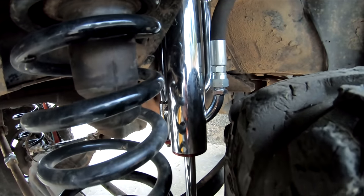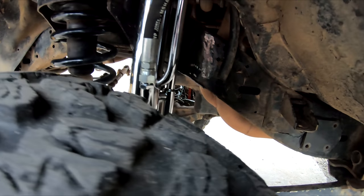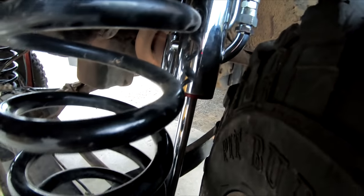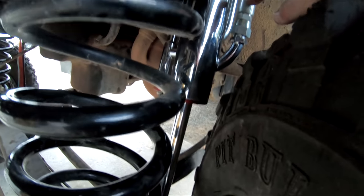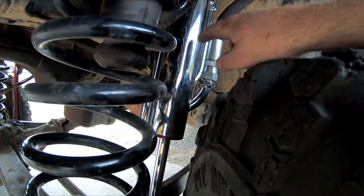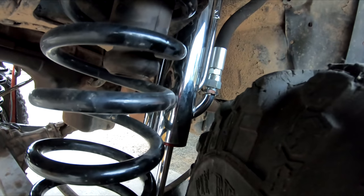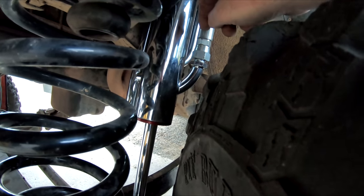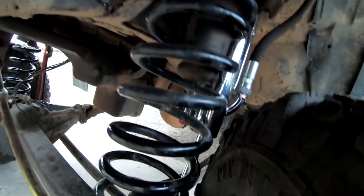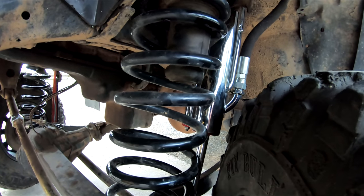You can see it's relatively tight, there's still a bit of clearance there. It's sort of hard to get a good view on it but there's still a little bit of room. What you've got to remember is when the correct shock's in here, the res tube's going to be on the inside and the bypass tubes will be on the outside. With the bypass tubes, they're 10mm narrower, a lot closer to the shock body - that gives you another 10mm there. There should still be plenty of room.